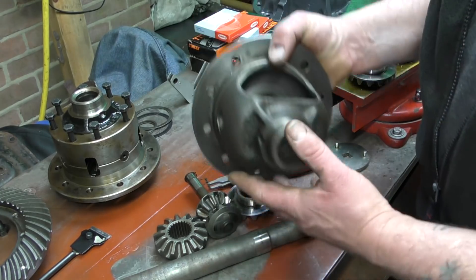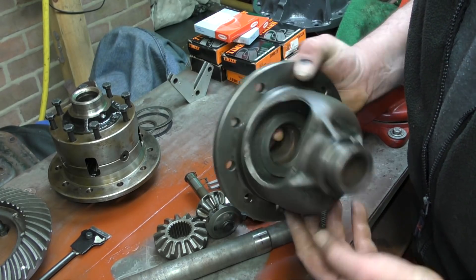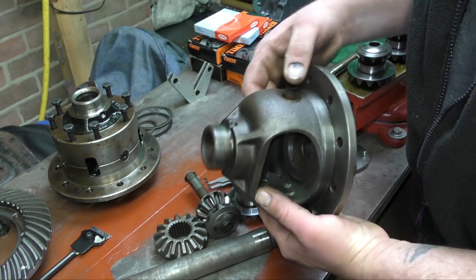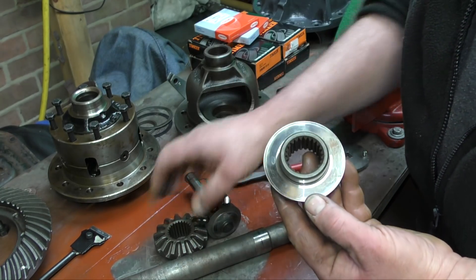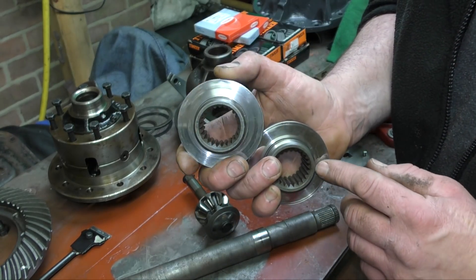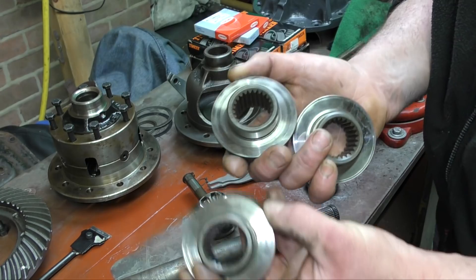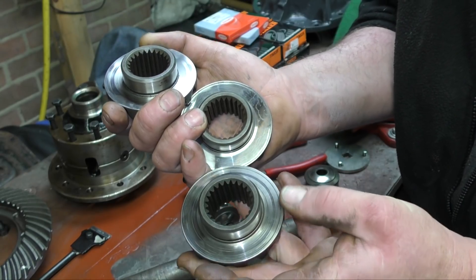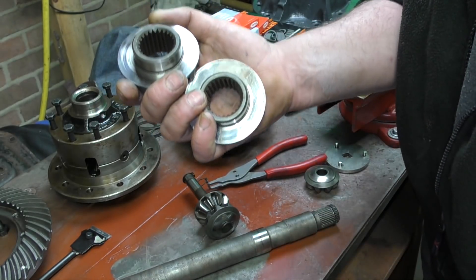On the bench I have another one which I kept just in case. This was something that had a crown wheel that was smashed, but the housing itself I did check over — it's been sitting in the shed for a while. As it comes to the planetary gears on the thrust side, you can see that's almost a mirror finish — that's okay. It hasn't picked up anything bad. No lack of lubrication, whereas the other one might have suffered from lubrication starvation or had something contaminating the oil which caused it.